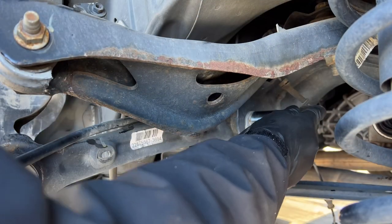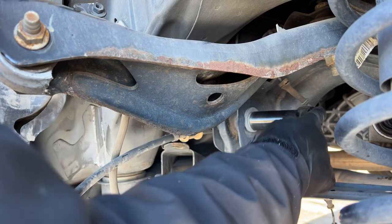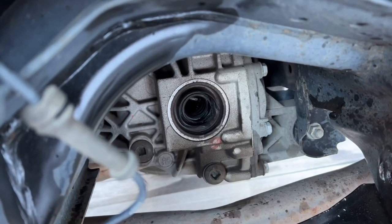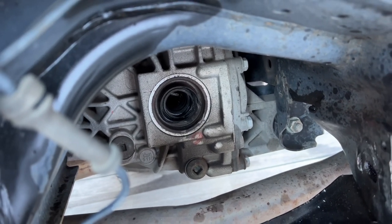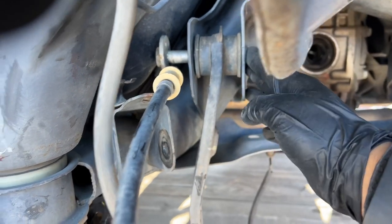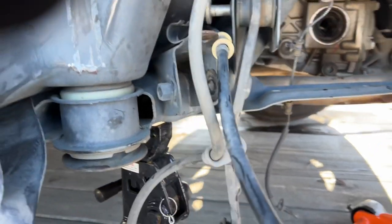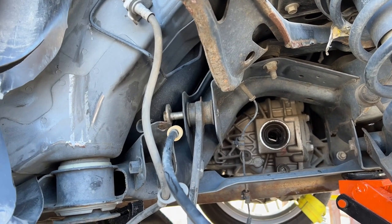When I was working in here I actually noticed that the seal on the rear differential is a little damaged, so I'm gonna end up replacing that. When I came to take off this upper link bolt — it looks like it's where you do the alignment — I tried to take it off and it's actually hitting on the fuel tank. So what I'm thinking is I'm probably gonna have to take these subframe bolts off a little bit and lower the subframe down to see if I can squeeze that bolt out.